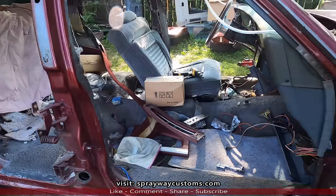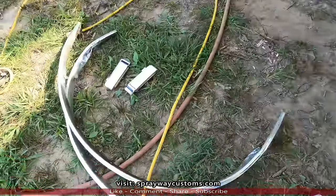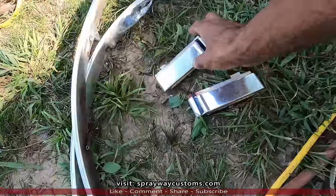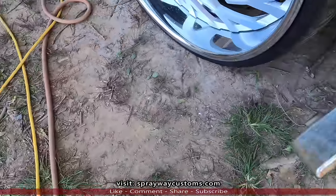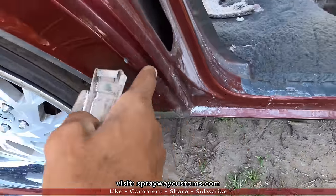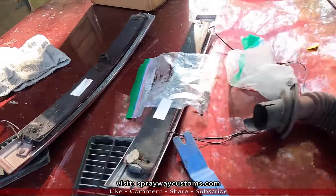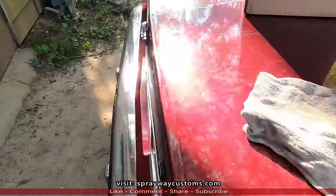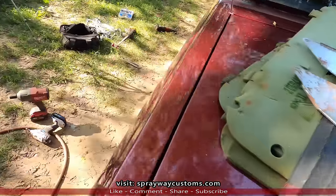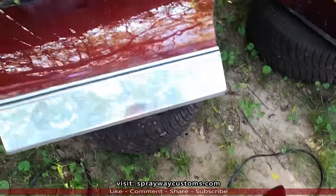I done finished taking the doors off, as you can see. I also took this trim here off so I can get to this trim that was back in the back, because I need to paint this when I paint the jams. Here's all the pieces that I took off. And the doors is over here. The mirrors.